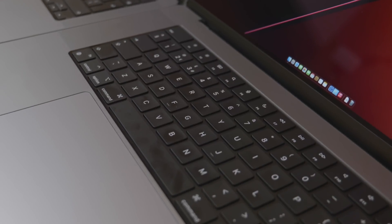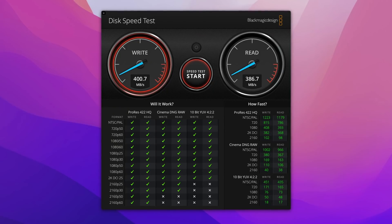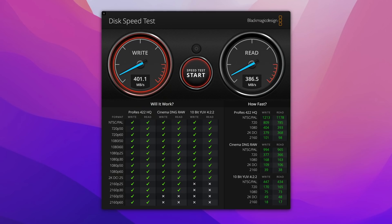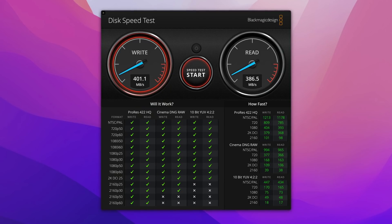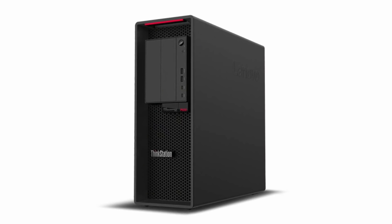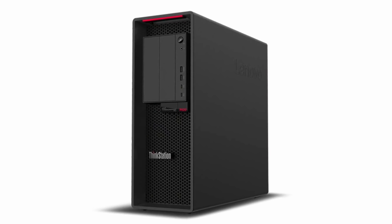What about the new MacBook Pros with the M1 Pro and M1 Max chips? I tested the M1 Pro in our 16-inch — the 10-core version — though there's no difference between that and the 8-core version. For the T5 drive, we're getting 401 MB per second for write and 387 for read. The M1 Max scores literally identical: 401 on write and 387 on read. So there's no difference between the Pro and Max chips, but USB performance on Apple Silicon has improved with these new chips — though only on write times for the T5 — and we're still lagging behind Intel Macs and PCs.